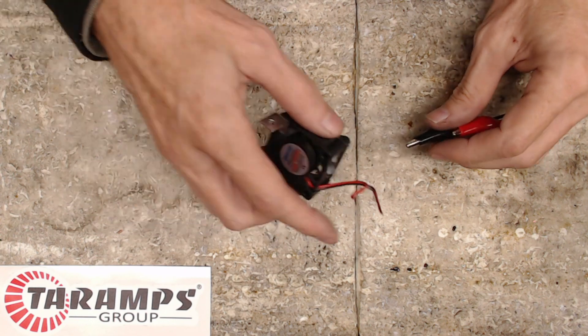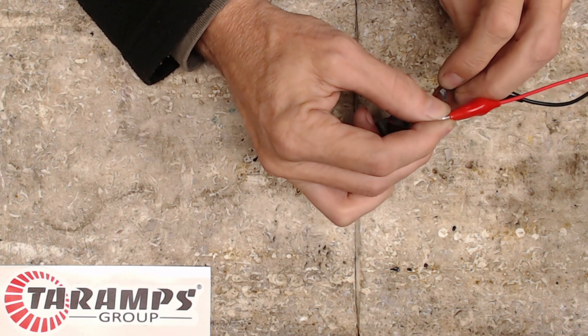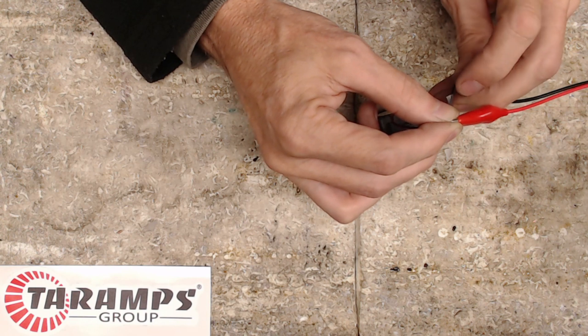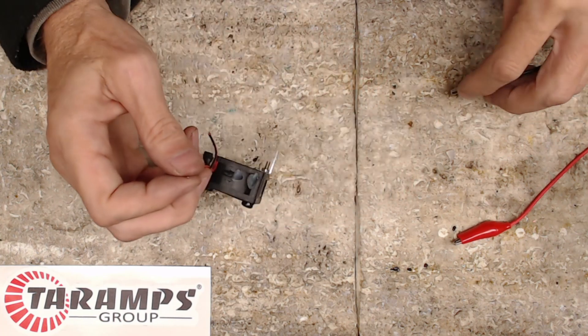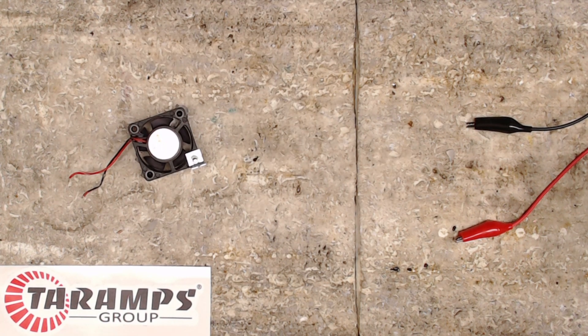So that's what I'm going to do for this fan today — clean it up and get it back into service. The first thing I do on any fan that comes in is verify the condition of the fan. This fan here isn't in that bad of a condition — it's got a little bit of gumming up on the bushing, so it's got a little rattle to it. Sometimes when it starts up it'll just vibrate really bad.